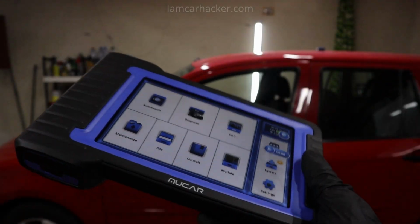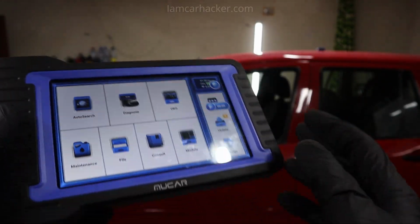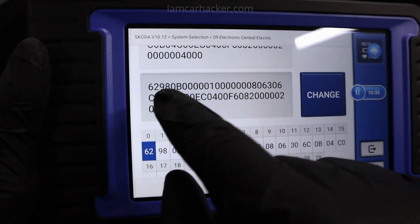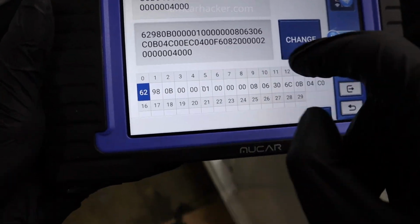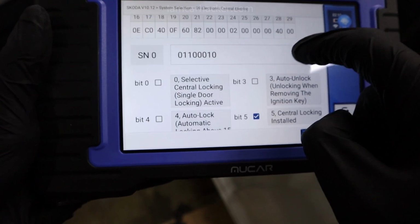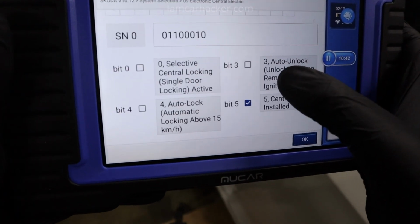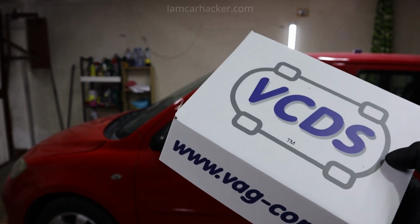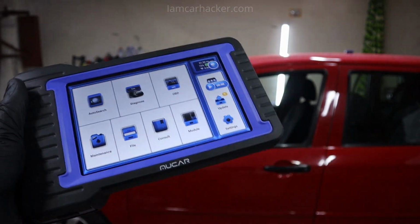And funny thing is that even this is entry-level scan tool, one of the cheapest scan tools you can buy. Not only it does everything that bidirectional scanner should, it also gave me a lot of OEM functionality. It actually can do pretty much everything that OEM dedicated software like this VCDS for VAG cars. And not only for VAG, for every car brand I tried it.